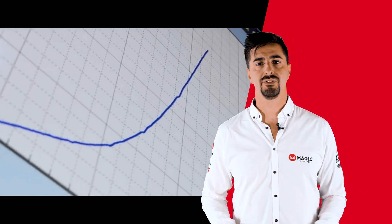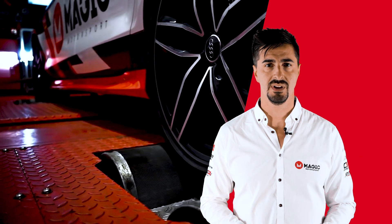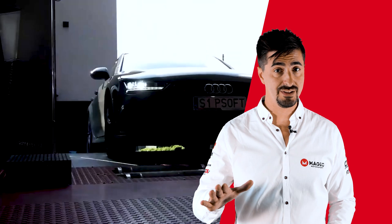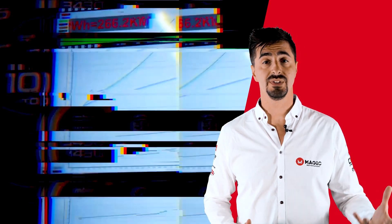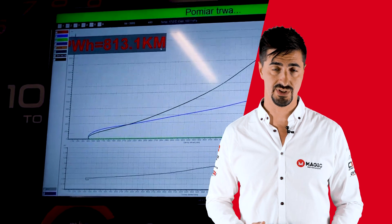There's a series of steps that have to be followed during the testing in the classic way, and they may have an impact on the results. You have to place the vehicle, anchor it, align it in order for the wheels to be perfectly placed on the rollers. Load and resistance are all important steps to obtain useful results for the user.